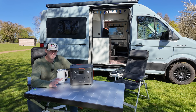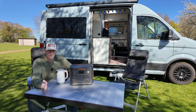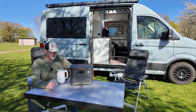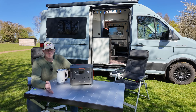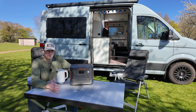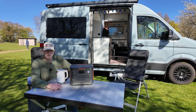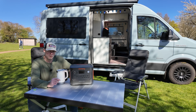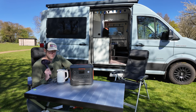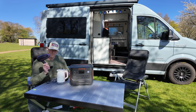Toasters range — usually around the 600 to 700 watts mark for a typical two-slot toaster. Hair dryers tend to range from about 700 to 800 watts up to 1,500 to 2,000 watts. Sarah's got a GHD folding travel hairdryer — let me grab it and check the wattage. GHD travel hairdryer: 1,000 watts on low, 1,400 watts on high. So you can run this at full power using one of these. So 1,500 watts output gives you a bit of an idea.